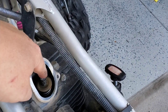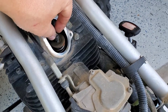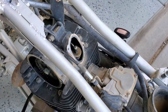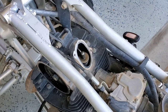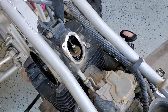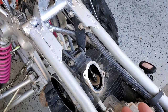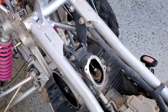I'll show just the intake side. We loosen the 10mm bolt and adjust the square-top tappet until the feeler gauge just barely grabs. On the warrior: intake clearance is 0.06 to 0.10mm, exhaust is 0.16 to 0.20mm. Valves get tighter over time as they hammer into the head — especially on the exhaust side. I'm going to set intake at 0.08mm.